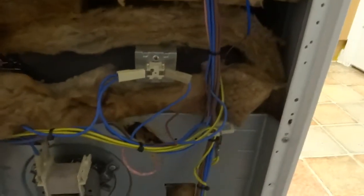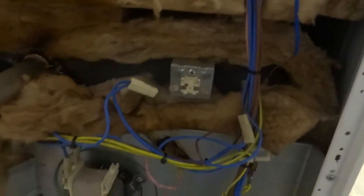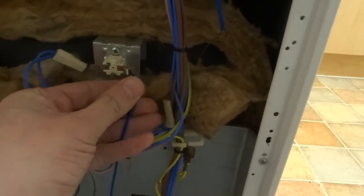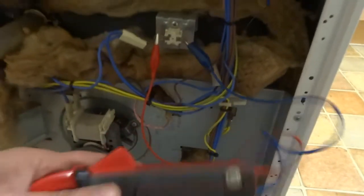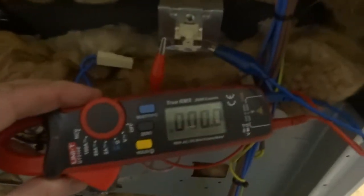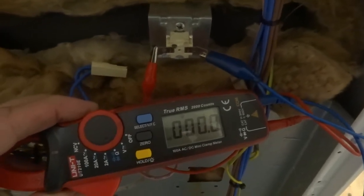Really easy to test and replace. Pull the wires off, remember which side goes which. You connect your multimeter to it, set to continuity. You should get a very low ohm reading — short circuit and continuity buzzer — showing you how it's working. Same with the top one: pull the wires off, check the continuity.